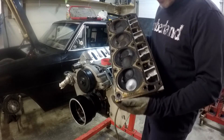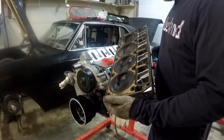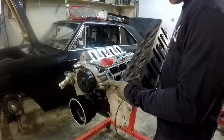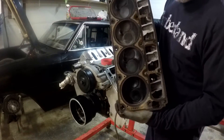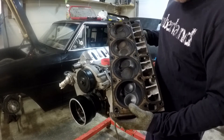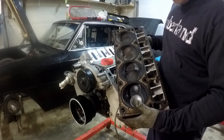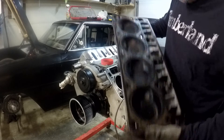These are 48 heads. The reason I used these heads is because I got them for free. The heads that were originally on this engine — the engine was in a truck fire and the valve seats actually dropped out from the heat. So I ended up using the valves from that engine, and we cut the seats ourselves. We widened them on the 48 heads to accept the valves out of the six-liter heads, and they're ported.